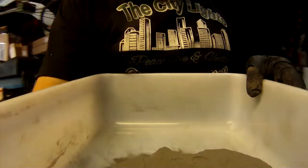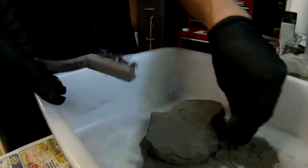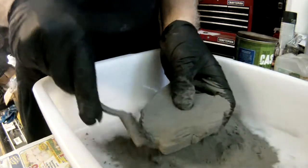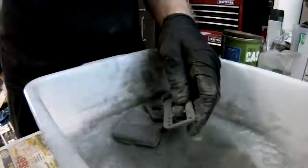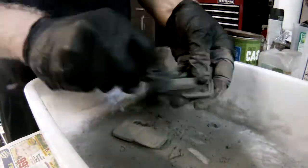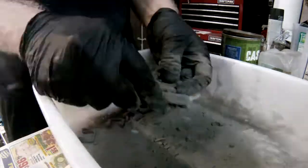Unlike a lot more complex projects, cleanup on this project was pretty simple. It's kind of nice not having to poke around with a dental pick for once. These prints are not completely flat — there are slight fillets and chamfers that allow the door handles to rest in a way that conforms to the door skin. The only wild card was the c-clips. Even though I knew the structural integrity of the PA-12 would be fine, I had some really fine thicknesses on part of the c-clips so I wanted to be careful. Thankfully there weren't any problems.